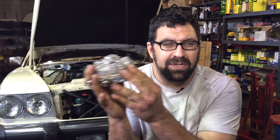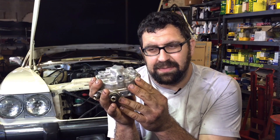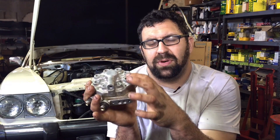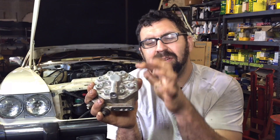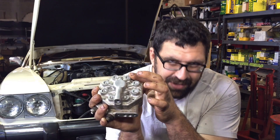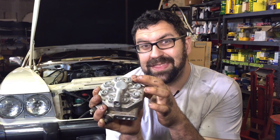One really common issue with fuel distributors is that when they go bad, you get a ton of gas being dumped in the oil. That's because the O-rings in these ports, which are located deep inside the fuel distributor and help regulate pressure, have failed, and now you have uneven amounts of fuel going to different cylinders. This will cause rough running, excessive fuel consumption, hard starting, but worst of all your oil will become contaminated with gasoline.